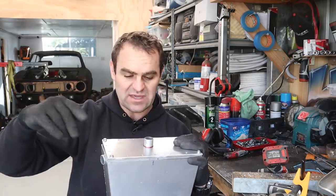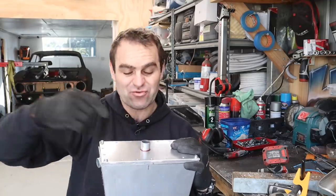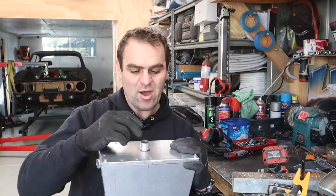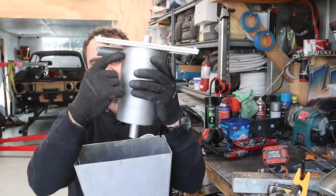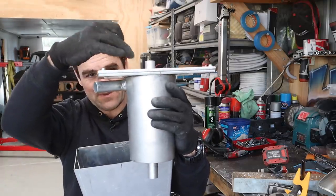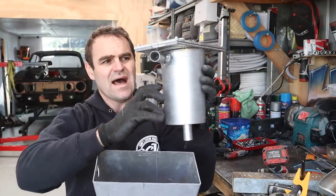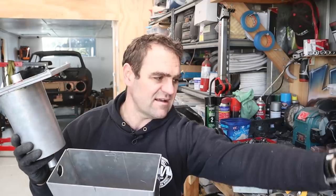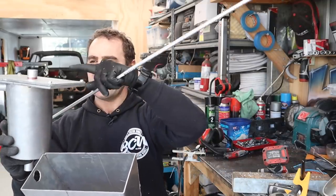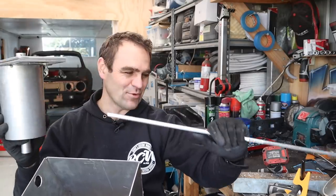There'll be a breather going in and then there's going to be a second breather coming out, with any excess gases and build-up going back into the inlet manifold of the engine. That is going to come out through this center spike. The trouble is the bottom of the spike is below the oil line, so given enough vacuum it would potentially even suck oil up through into here. I don't want to just drill a hole in it near the top of this cylinder either, because the oil will be quite violently sloshing around inside. So what I'm going to do is get another little piece of tube and make a breather for the breather — you'll get it when I put it all together.